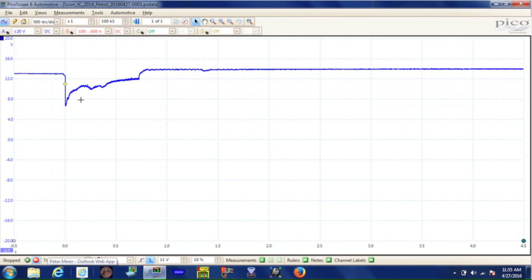Now we go on to the point where the engine is starting to crank — it's spinning over but has not yet started. These little humps that you see are actually the impact of the individual cylinders as they come up on their compression strokes. Again, we're looking at only half a second of time, so it's a very short period. We'll talk a little more about that on the current side.